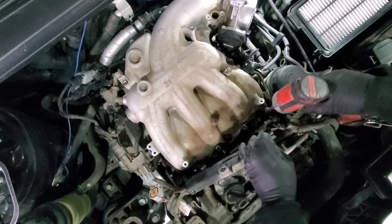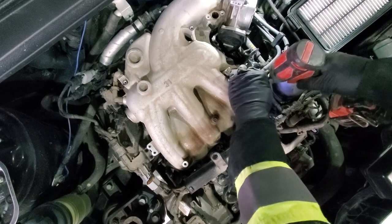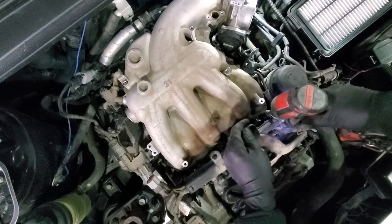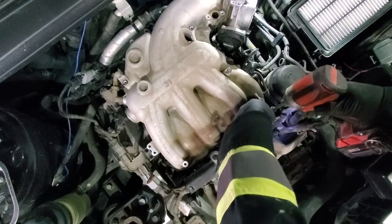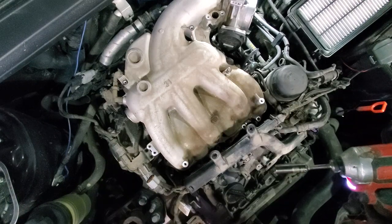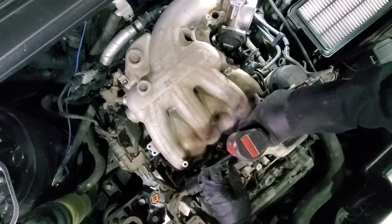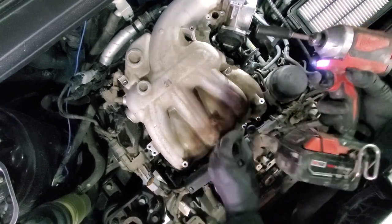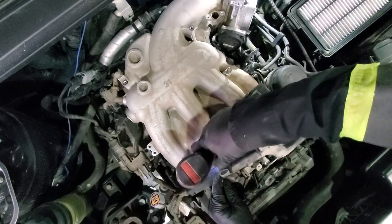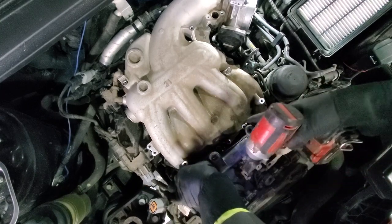This line is now loose so we have clear access to those three bolts. We'll use a 12 millimeter socket to get the rest of the bolts and nuts. A flex-head ratchet is a nice tool to have when you work a lot on vehicles.